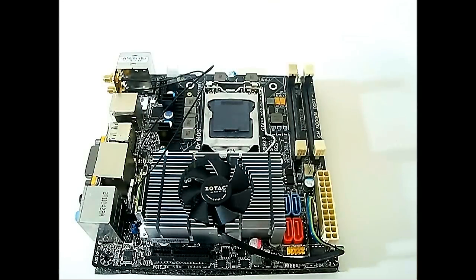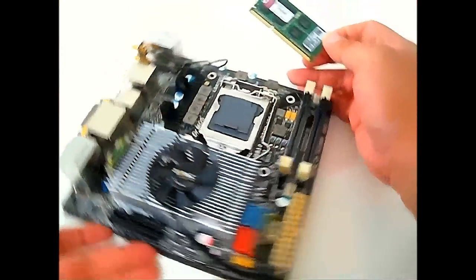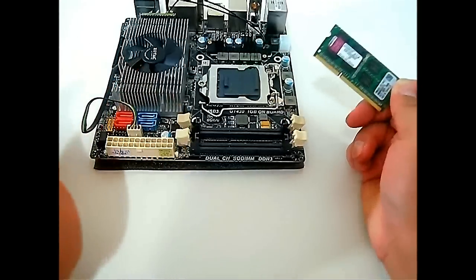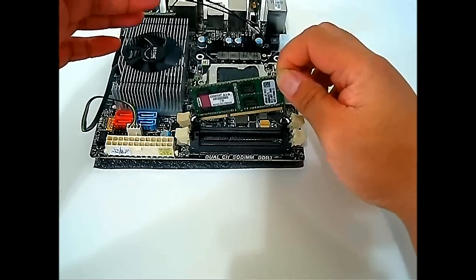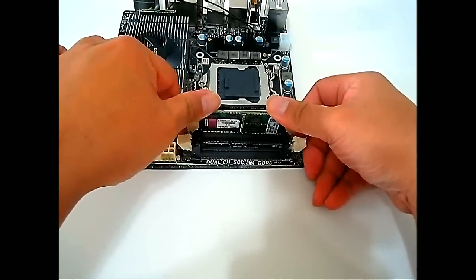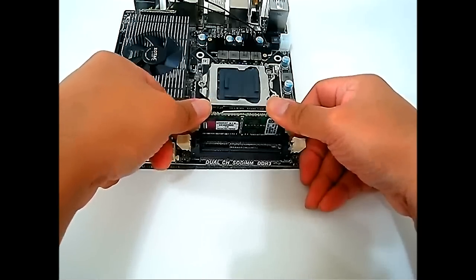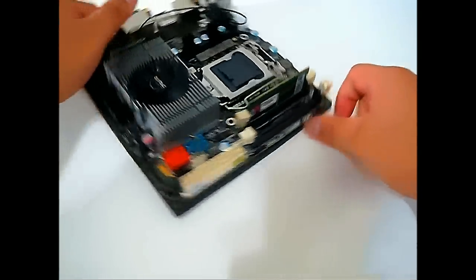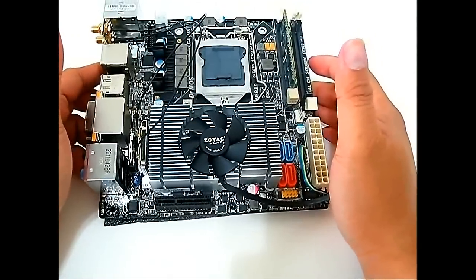To build a system, we will install an i7 processor and a pair of SO-DIMM memory modules. Make sure the SO-DIMM you choose is compatible and appears on the QVL list, because there are many RAM modules out there and some are only compatible with specific laptop brands. For example, the Kingston KVR1333D3S9 is on the compatibility list, but there is a different Kingston KVR1333D3S9 variant that is not — so verify your exact RAM model is compatible with the Zotac Z68 ITX Supreme motherboard before purchasing.